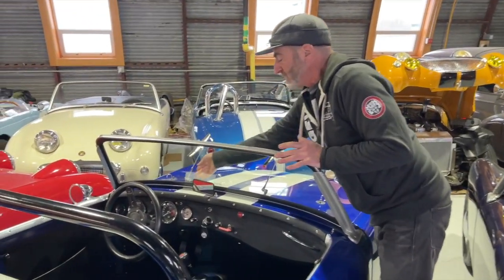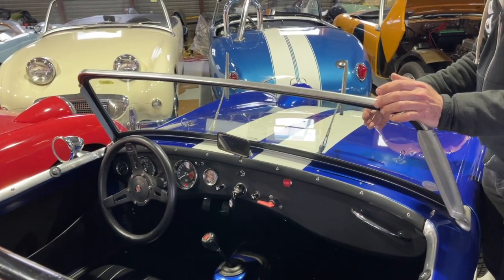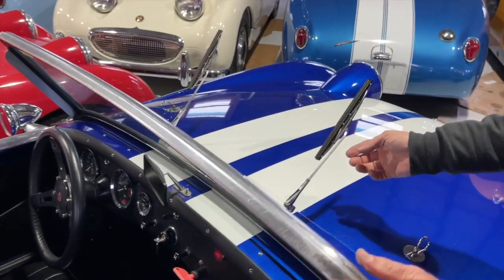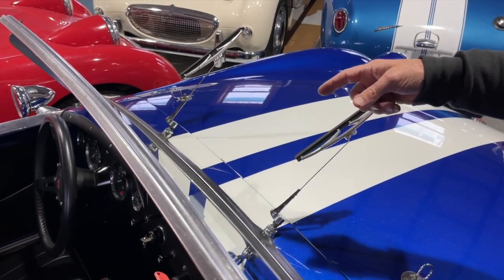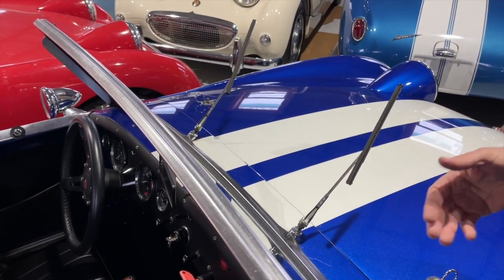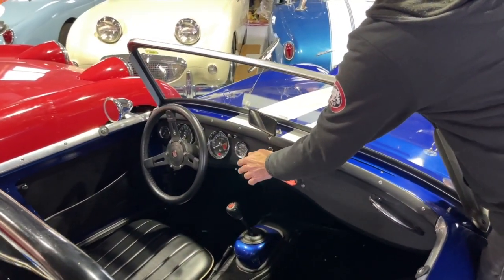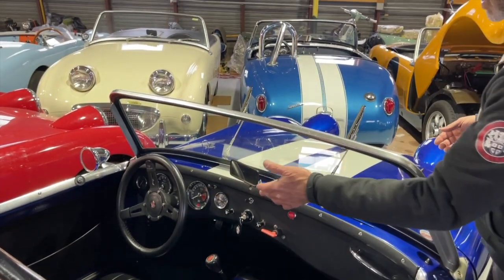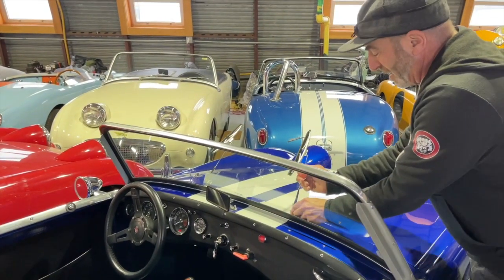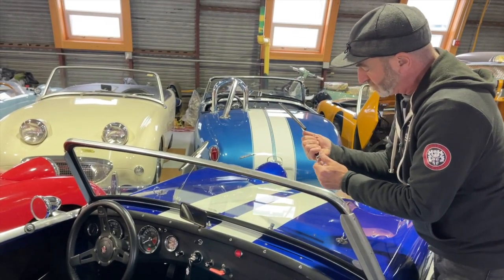Let's try this one. This is a car called Royal. And this one has yet a different issue. If you look at the speed with which these are moving, or lack of speed, this one is just completely gummed up. The cables are binding more than they should, or the motor is tired and worn out. Some combination of all that. Now, fortunately, let's see if it parks. Yeah, this one parks. So again, switch is off, power's still going. You got to the little red spot, motor stopped. But fortunately on these cars, you're never really using the wipers. It's not a big issue.